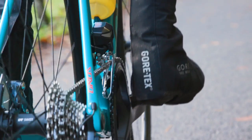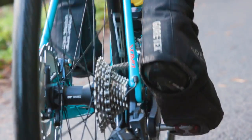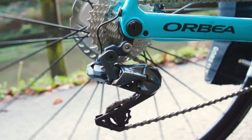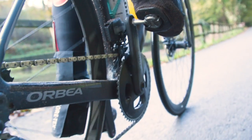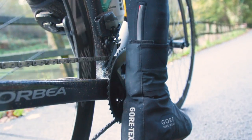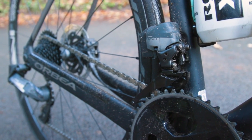Not all riders will want a computer deciding when to shift the front derailleur. You can run the system fully manual, but for those riders, there is also a halfway house option, which Shimano calls semi-synchronized shifting, or semi-synchro if you prefer, and SRAM calls compensation shifting, which is where you do all your normal shifting actions and you shift your front derailleur. But as you shift your front derailleur, the rear derailleur moves a couple of cogs, and that gives you a smoother progression through the gears.